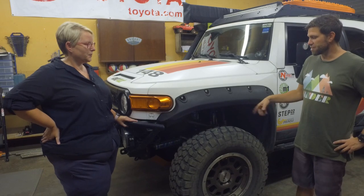Why didn't you do the three-inch extension? I didn't really want to get into a fiberglass fender — it's not really my look. I wanted to keep it fairly stock looking. And then when you do that long travel, you have to get longer half shafts. Is that all within the set? Yes. So if you buy the kit, you manually disassemble your old ones and put everything together with the new CVs on the new half shafts.